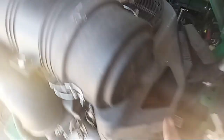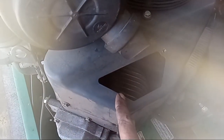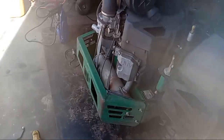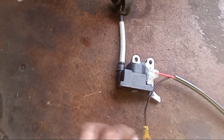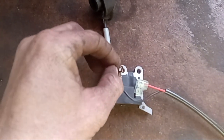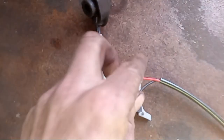On this particular motor, you're going to have two caps. There's one right here, which were on here, and you're going to have one on this side. Now to quickly find out if you need a new coil or if it's something else in the wiring, this is what you're going to do — and you're going to do the same thing on most machines; it could even be a small chainsaw or whatever. Every coil — I'll show you on this one here. This is an example coil. Here's your coil, and your coil is going to have a ground going to it, which usually there's a bolt going through the ground. But the one you want to pull off is this primary wire coming in here. They usually just slide right off, and you'll see this little tab right here — that's how you know you got the right one.